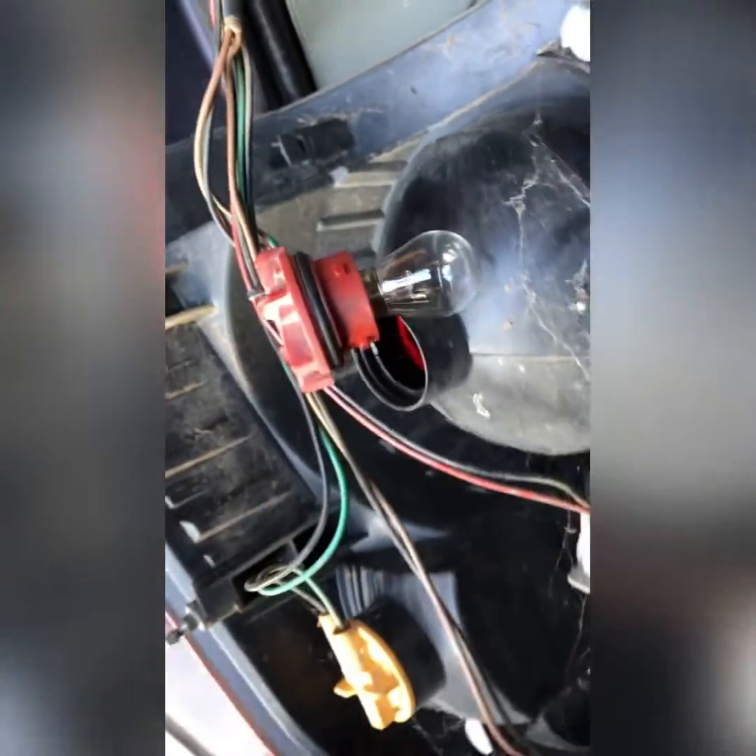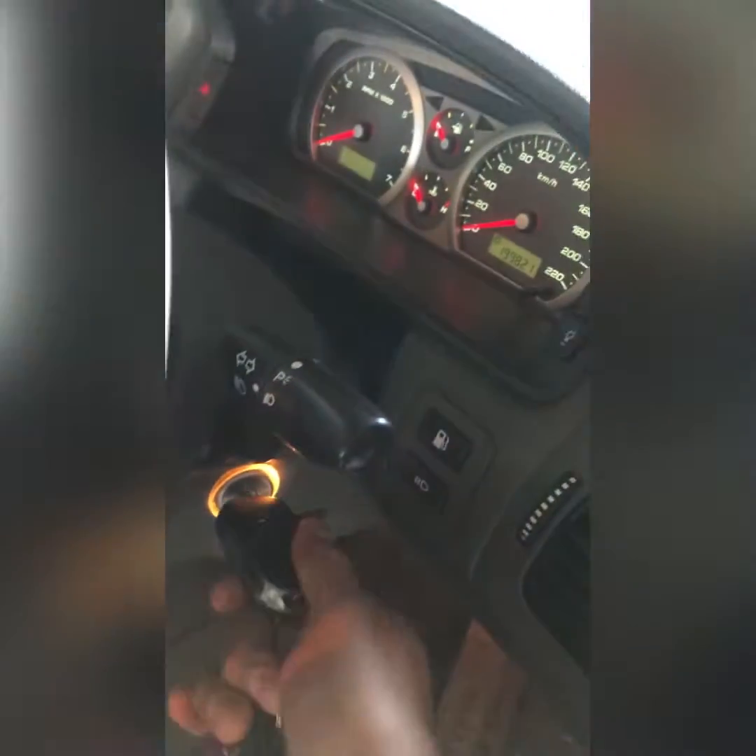So once you've got it in, just give it a test. I'd like to test before I bolt everything back on — you don't have to with these ones, it's pretty easy to take back out if you have to. So I'll just turn the tail lights on first — there we go, good. And then I'd like to test the brake as well, so I'll just use a brick to push the brake pedal down. Lights on, test the brake lights — and it's a bit brighter, it's coming on now. So that's a good test.